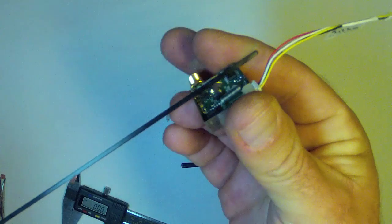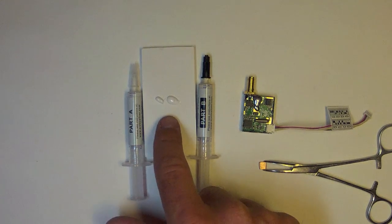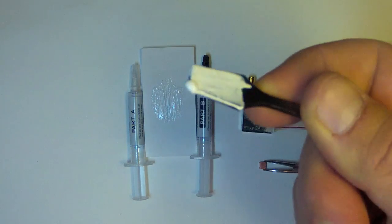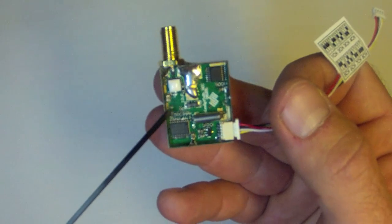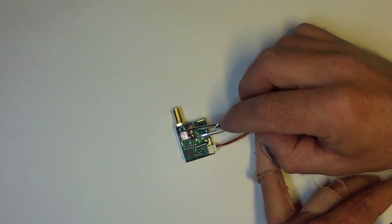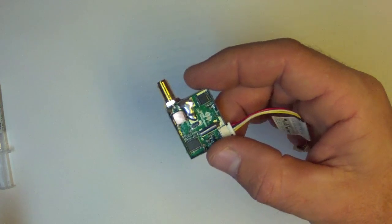The copper piece needs to have the thickness to bring it up to the surface of the case. I've milled this piece down to 5.7 by 5.7 millimeters, and the thickness is 2.13 millimeters. Express a small amount of part A and part B epoxy onto a smooth surface and mix very thoroughly but not too vigorously — you don't want to introduce air bubbles. Take one small pure bead and put it atop your clean RF chip. This epoxy conducts heat but not electricity, so it's okay if some spills onto nearby components. Then place your piece of copper right atop the RF chip, perfectly aligned, ensuring it's not touching any other electrical components, and press down firmly.